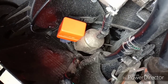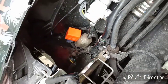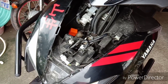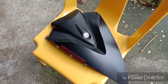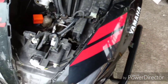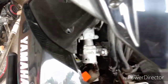That bright orange object is the flasher, which is pretty obvious — it just plugs in. You take the old one out and put the new one in. It comes out really easy; there's only two screws. You give it a little tug, this down here snaps, and the two screws are located up here and over here. That's pretty straightforward — you just have to work it off.